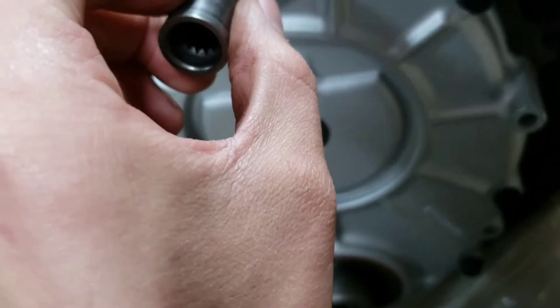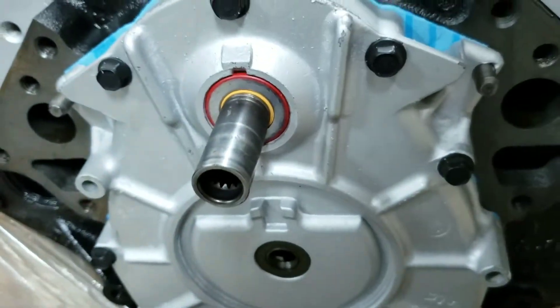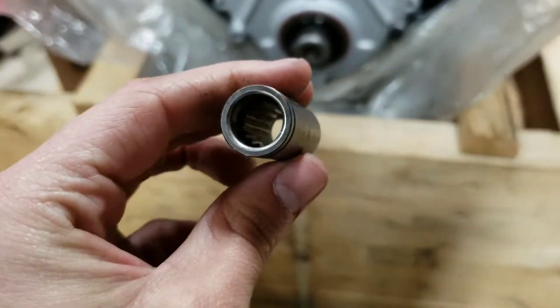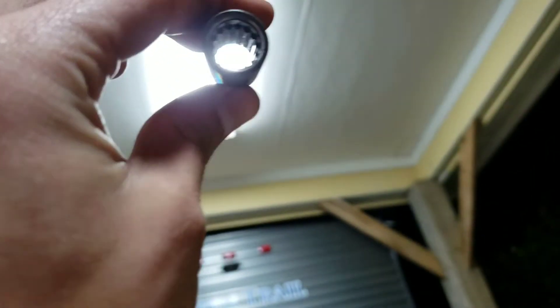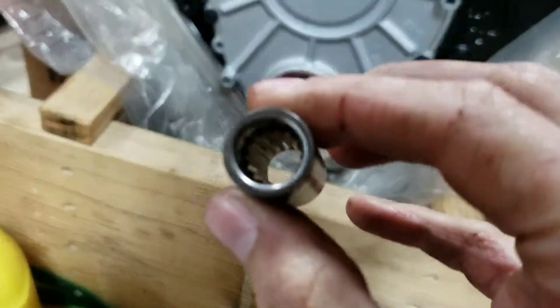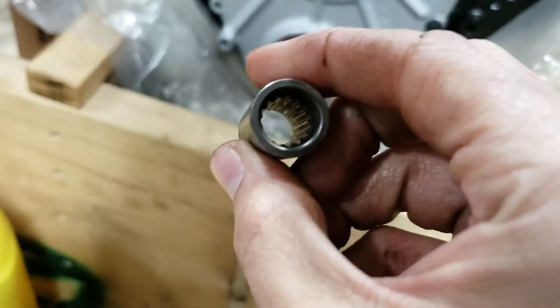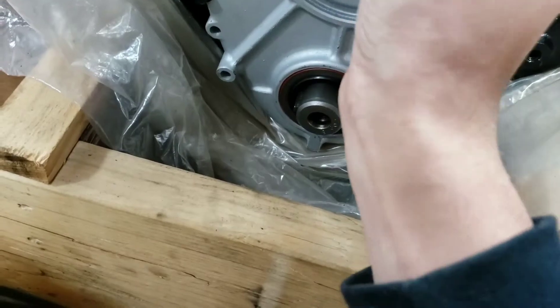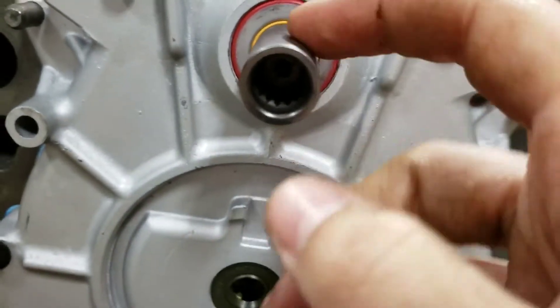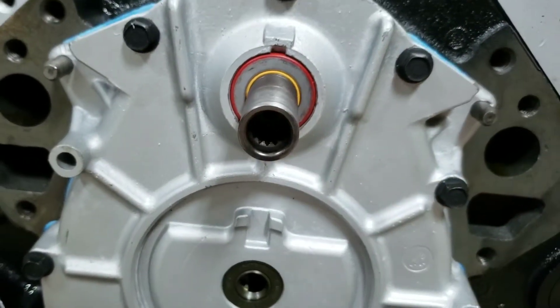So that's why it matters which way you put these on here. I took this off the old engine, so as you can see I've cleaned mine out - took some brake cleaner and a shop rag and cleaned it out. But you want to make sure whenever you're putting this on your new engine to repack it with grease, because there's a lot of movement there. That shaft, the drive shaft, is moving inside of this coupler, and then this is splined into the water pump.